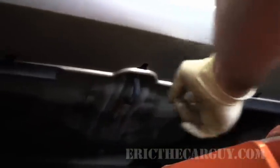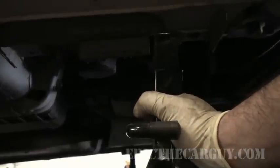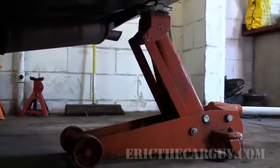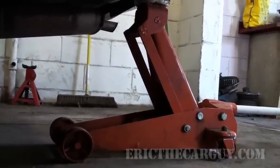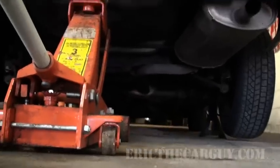Another question I get asked a lot is, Eric, where do you jack the cars up? Well in the back this is what I use. If I'm just jacking up the back of the vehicle there's this guy right here — that is a tie-down for when it's on a car carrier, or if you put your car in a ditch a tow truck driver will put a hook on this. It has enough structural integrity to support the weight of the vehicle, so that's exactly what I'm going to do. People also ask me about jack stands — well, right here and there. I let the jack down and let it rest on the jack stands but I just leave the jack up so that when I go to take it off the jack stands it goes much more quickly.